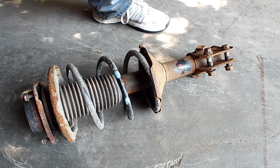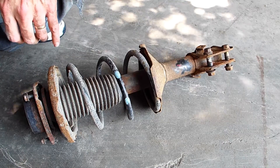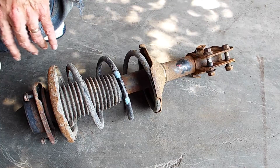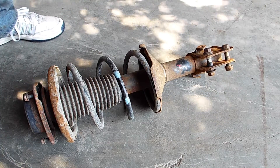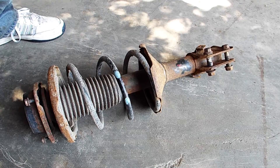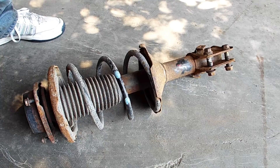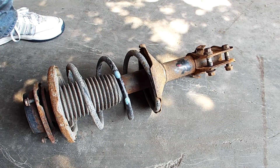There's no leak unlike the one in the Subaru right now, which is leaking. When I go down a bumpy road with that strut in terrible condition, the front passenger wheel bounces over the bumps as though it was a basketball just dribbling. It's very annoying and affects the handling. Time to swap it out with one that still has its gas charge and fluid to cushion the bumps.